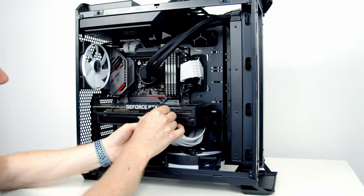So the next thing I did was I removed the front panel, front dust filter and bottom dust filter and reran the tests again. I sometimes will do this when I'm running my thermal tests, but when I looked at the front panel and dust filters in this case, I wasn't convinced they would make any difference in removing them. And taking a look at the results, I was completely right. Our CPU actually ran 1 degree hotter with the front panel and dust filters removed, while there was no difference to our GPU temperatures. And this is obviously within the margin of error, and it shows that the front panel and dust filters in this case are so good that removing them doesn't make any difference.